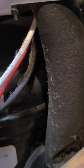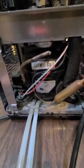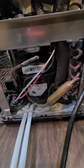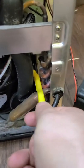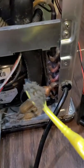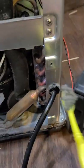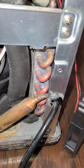Also, it will help cool the compressor — the compressor is a little bit on the hot side. It'll be a little warmer air going through, but not as warm as the compressor, so it'll actually function for two purposes now. While I've got this opened up, I'm in here with a toothbrush just cleaning the dust out of the back of it. Get a relatively straight cheap toothbrush and go after the back side of that condenser as best you can to clean it up.